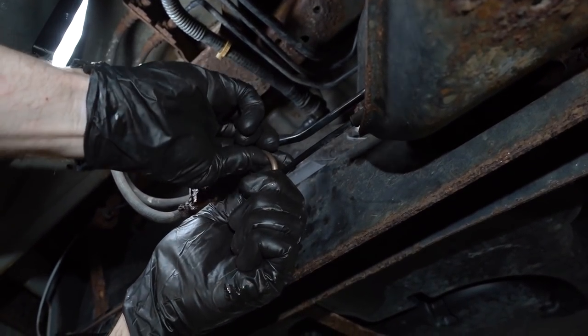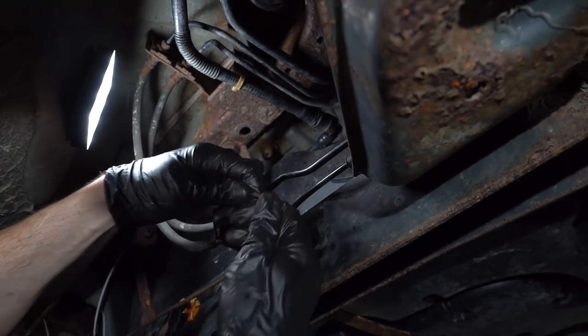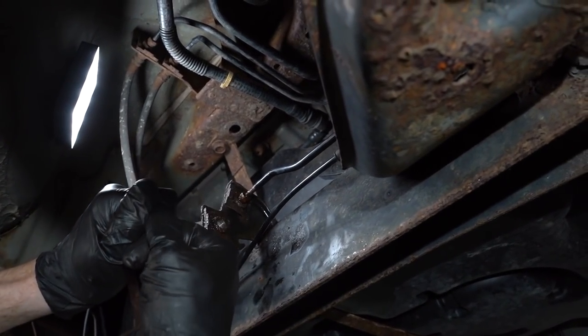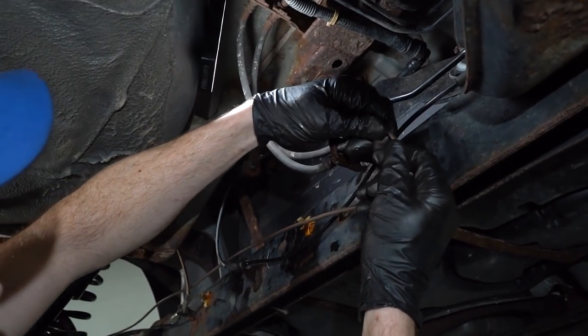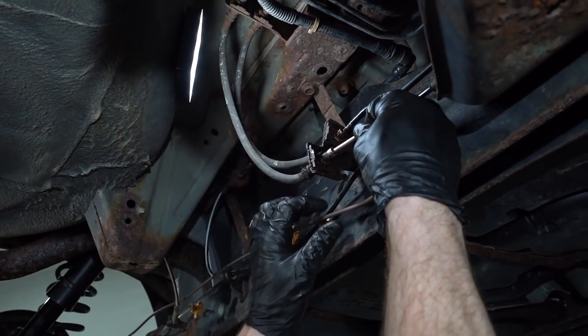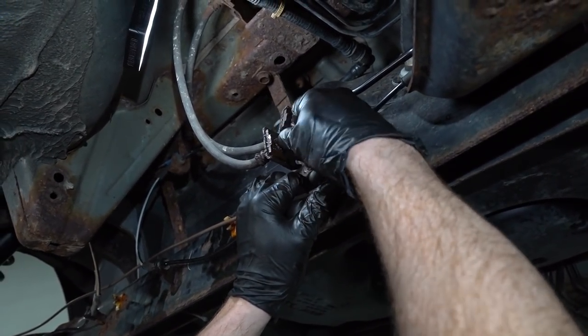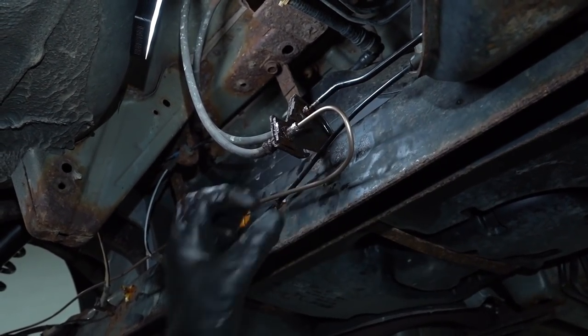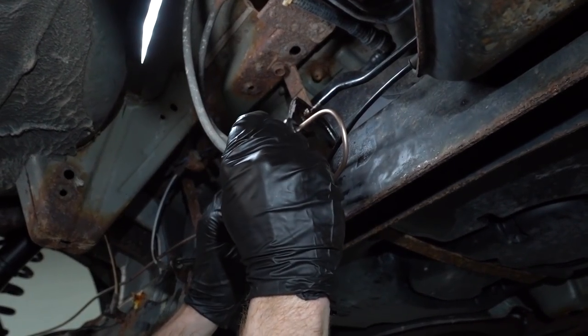This one, like I said, this tubing right here is just, it really is amazing in comparison to using the steel line. This is just a lot more forgiving. If you make your bend in the wrong spot, generally you can just kind of reform it a little bit, which is always a special treat, especially the longer the line. Last thing you want to do is have to remake a line. Go ahead and start this in.